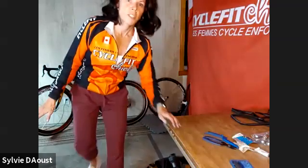My question for you is, it's not so much dealing with repairs. It's just once you come back from a wet, gritty ride, what should I be doing? Well, you could do one of 2 things. You can wash down your bike right away with soap and water. They don't recommend using a spray hose, just because you can shoot water into the holes where your cables are. Most cables now are in the frame, so if you spray water, it'll just follow right into the frame.